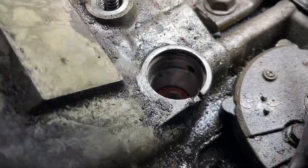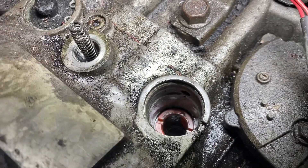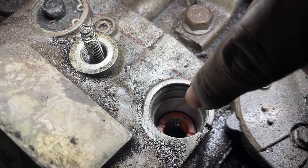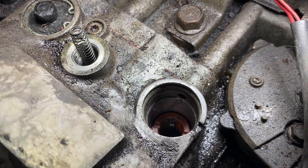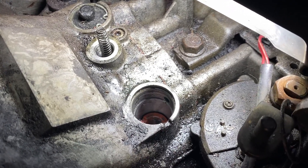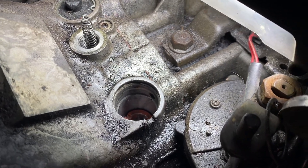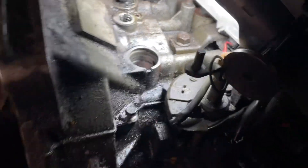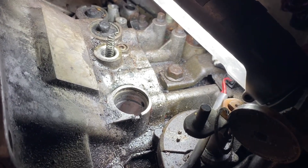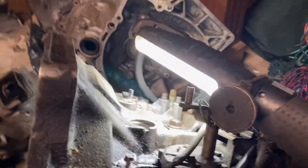What you'll do is stick your washers and nuts down into that port on top of that piston. On this one — the one-to-two — you have about an inch and three-sixteenths of space between the cap locked down and the top of that piston. Once you get that space filled up, you put the cap back on with the circlip. It'll hold that piston down so it won't move anymore, keeping the pressure out of that port and sending it right to the valve body.